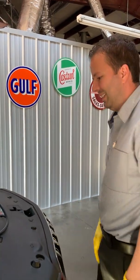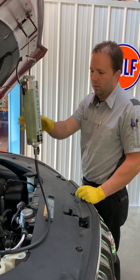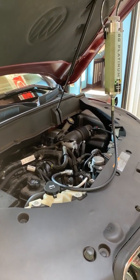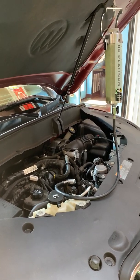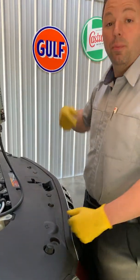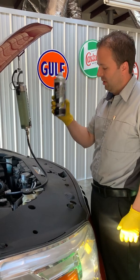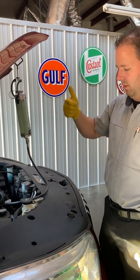About every 45 seconds, I will rev the engine three times to continue to pull this fluid. We're going to keep repeating that process until all the fluid is consumed, then refill it with the second can — same material, same chemical. We'll run through that can, clear any fault codes if there are any, drive it, and it should be good to go.